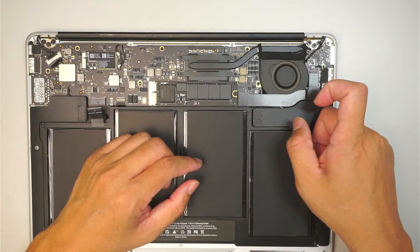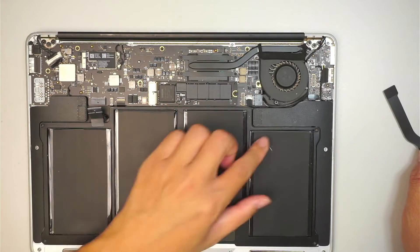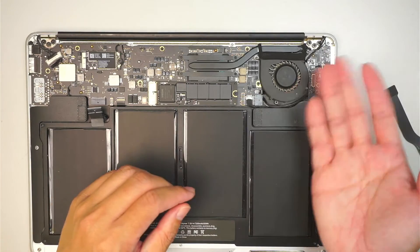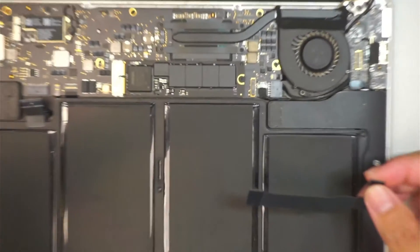That is the CPU fan. The CPU fan is making noise — when it spins I can hear the little blade scraping the metal, giving it a little buzzing sound. So we'll go ahead and replace that.